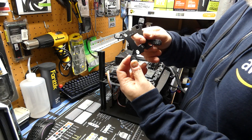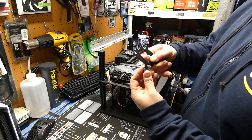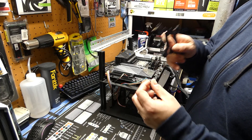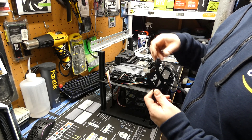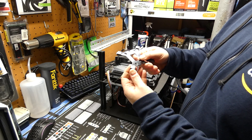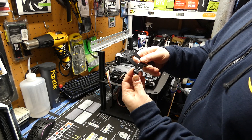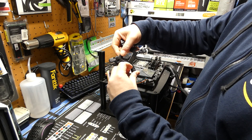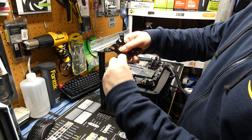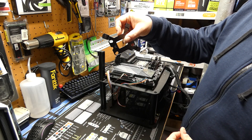The first thing of note is that you have to adjust the back plate depending on the Intel socket. The AMD install relies on the actual plastic clips to hook onto, so you only need a back plate for Intel. It's got two markings — for LGA 1151 and 1700 — and they're very well defined. You just pull it back and it's ready for install on 1700.